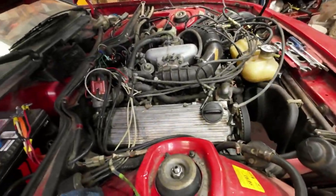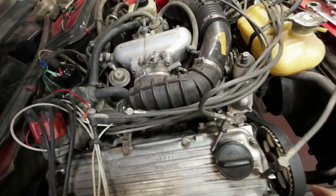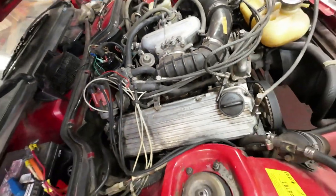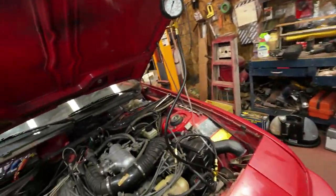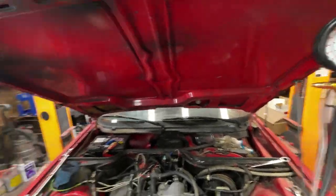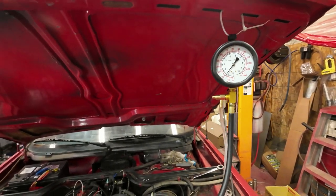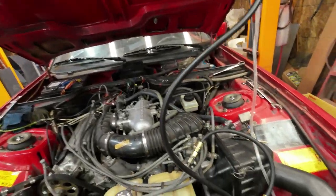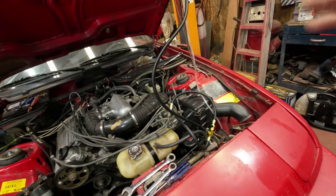Wonder what happened there. Did you get any of that? No, not likely. So I'll put the injectors back in and be careful not to knock any dirt into there. And that should be okay. Now the next thing after this, I'm still waiting. I don't know if you got any of that. Still waiting for another 6 minutes to see if it stays above 1.1 bar, which it's getting close to, but I think it might be okay. That's with this closed. Now I'll do it again with that open, but that'll be after.